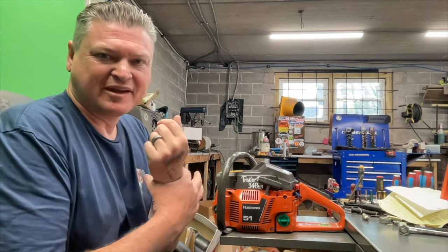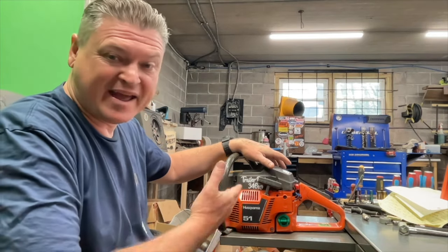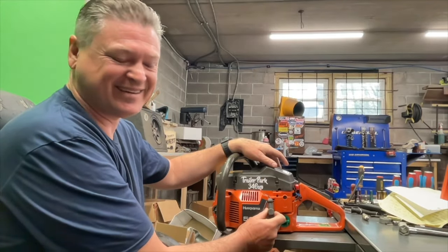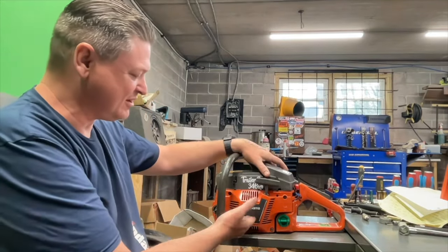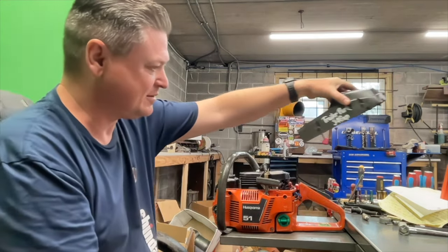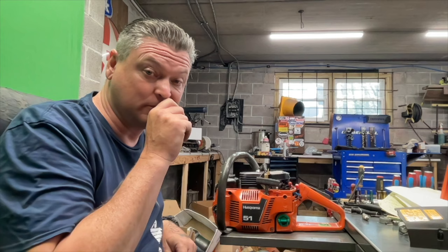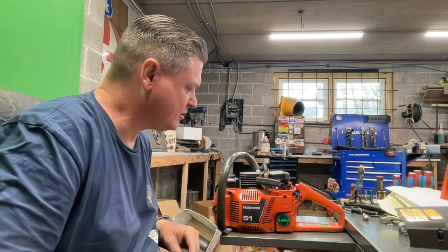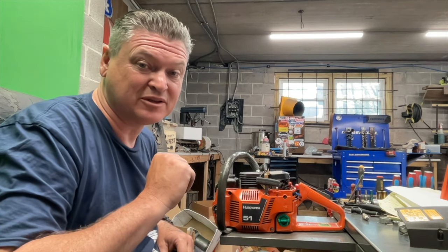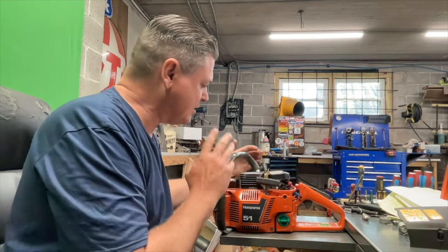Next up, and possibly the last one, I don't know, on the looky-loo of the Matt House built Trailer Park 346 XP. He used, obviously, a Husqvarna 51, and what he did was he adapted a Husqvarna 350 cylinder setup and piston, I believe. No, he's got a Domar piston in there. I can't remember what Domar piston he used. But he said no chamber work was done whatsoever, just base cut and port work.